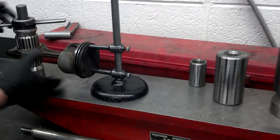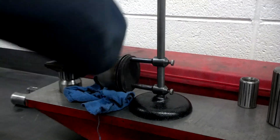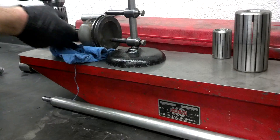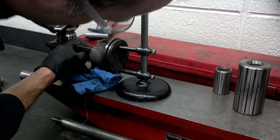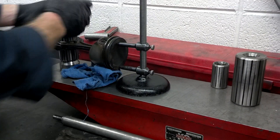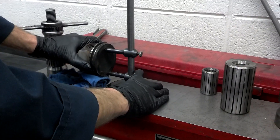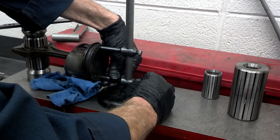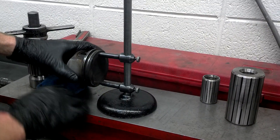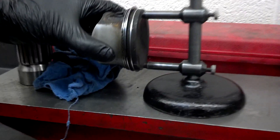In this case I'm going to have to raise this up just a little bit — I'm going to put a rag under it so when I loosen it it doesn't drop. I'll bring this over here and set these up so that it touches two even spots on this piston. We want to make sure that it's contacting both. And in this case we can see that it isn't — there's a slight gap right there. And we would use our feeler gauge.